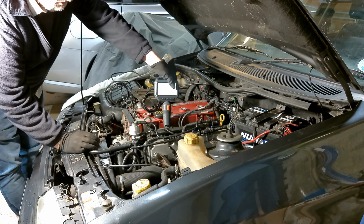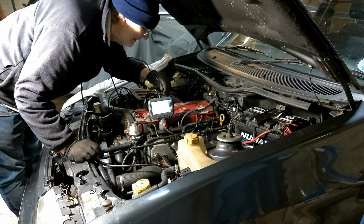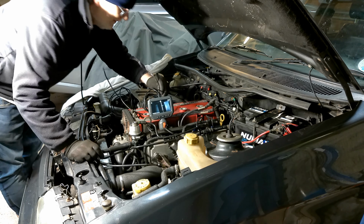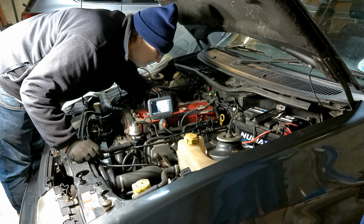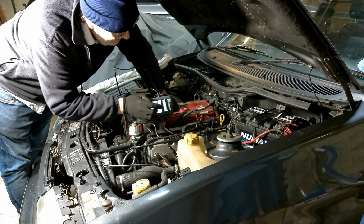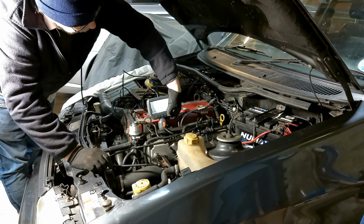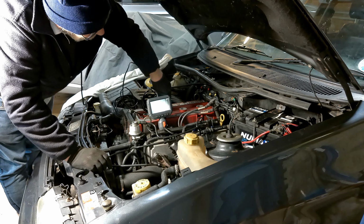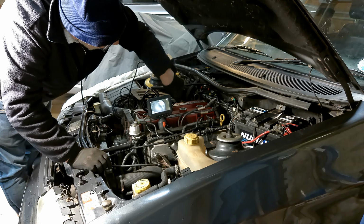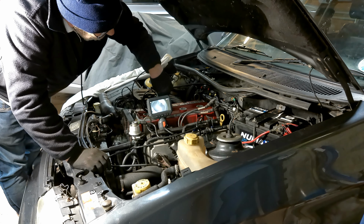Now I'm going to be checking 2 and 3. So we're going to have a quick look down here. It's a number 2 piston. I'll have to do a long press on that button. That's not doing anything. That's it. Okay, so this is the number two piston. And yes, it's got these telltale marks on as well. So we've got two grooves in this piston, but other than that, it doesn't look too bad.